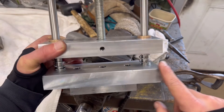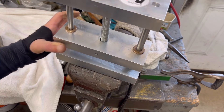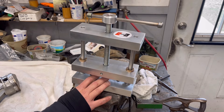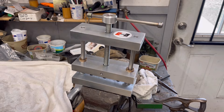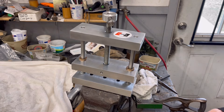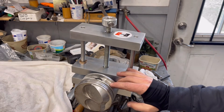You got your rod right here that moves this clamp. It's got springs, and this is for the vise. Literally, you just put it in the vise like that, clamp down. That bottom piece clamps in the vise, gets it nice and secure. Now this is aluminum — a lot of rods that we do use are steel, so aluminum is softer and helps it not mar. This is an aluminum race rod, just for representation — you still got to be careful. This goes up and down like a vise would, and it's got springs that help push it apart. You slide this in here, go down, and clamp it down. So if you're going to put in your spiral locks or your snap rings, this makes it secure and a whole lot easier to do.